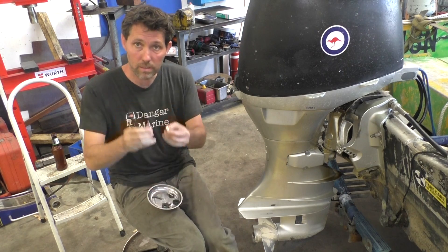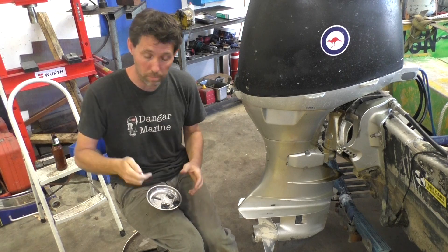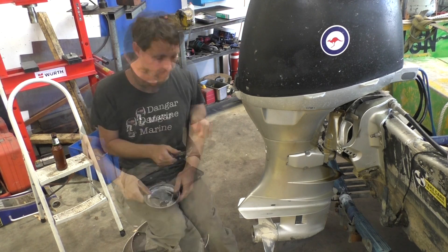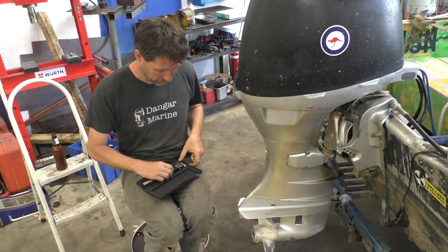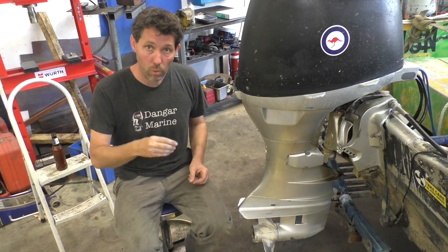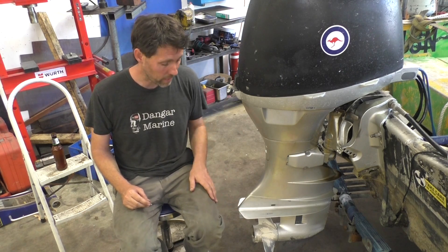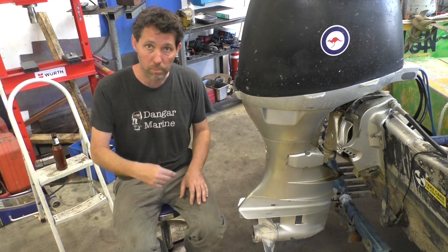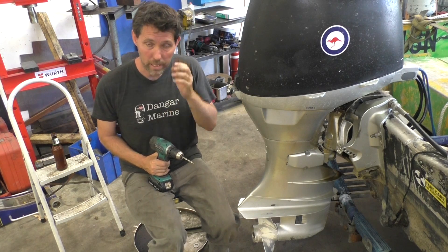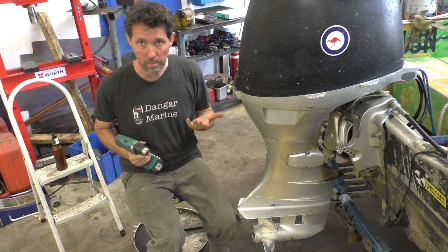There are two lengths of bolts in the kit — short and long — so obviously the longer ones are going to go at the back where that hole was deeper on the plate. I'm just going to measure the diameter of them so I can pick the right drill bit. So they're 6mm bolts, a little bit over. I'll go grab a 6mm drill bit. The bolts go all the way through into some nylocks, so I don't need to drill too small and tap it. I'm just going to drill them the full 6mm so they can push straight through. Because those bolts came out at 6.11mm, I might need to go to a 6.5mm drill bit, but I'll start with 6mm so I can always take more out.